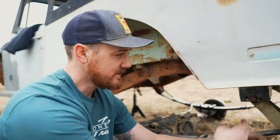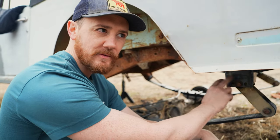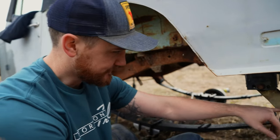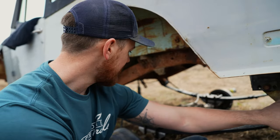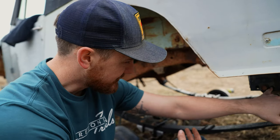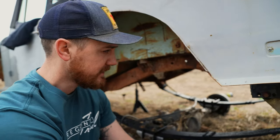On these I did go ahead and drill three different holes an inch apart, so if we are a little bit off we have a little bit of adjustment. This shackling looks okay, but obviously there's not a whole bunch of weight on it yet, so we might end up just using this one. Like I said, I can always move it back if I need — I'm going to weld it into place — but we're really close.